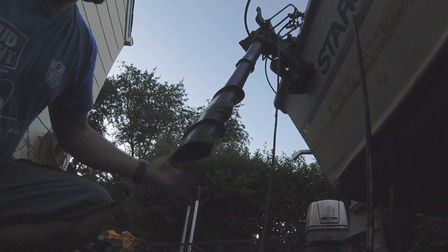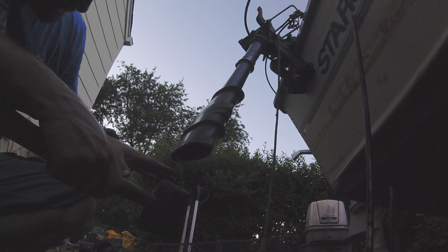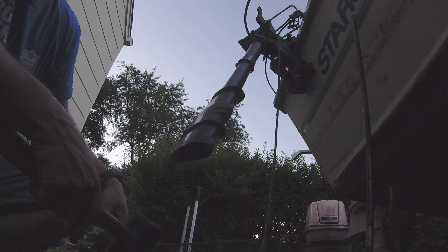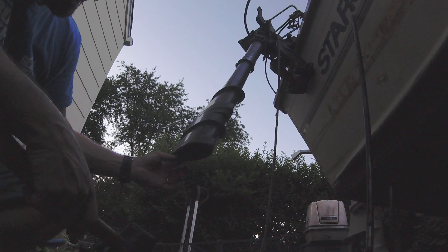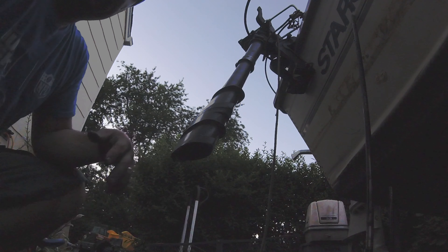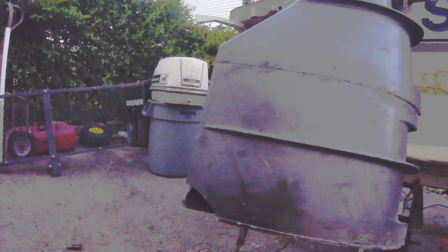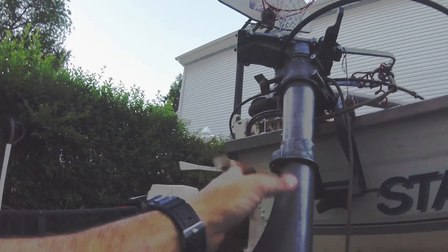This piece should have fallen off by now and there's nothing holding this bolt — that's how solid and rough this unit is. Everything is fused together. This bolt and this section here were fused to the lower unit, stopping it from dropping out. Usually the drive shaft is stuck in the power head, but this one had this long bolt. The connecting bolt needs to be drilled out and tapped so that when we get a lower unit we can bolt it right up. There's a big piece missing but that'll just make a louder exhaust port — that part will most likely be underwater anyway since the water sprays out here. This motor can be saved; we just need to find a lower unit to fit.